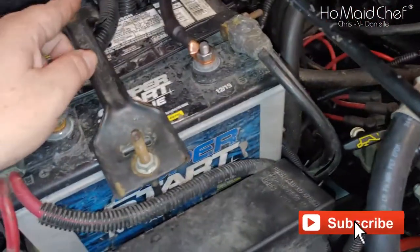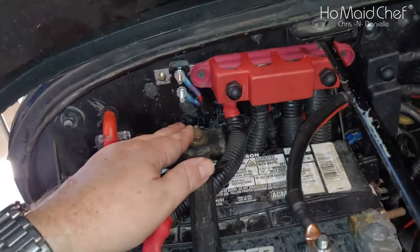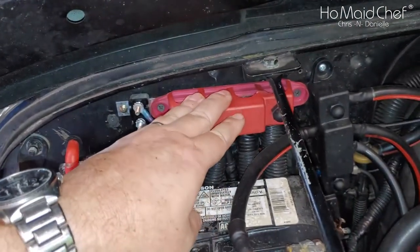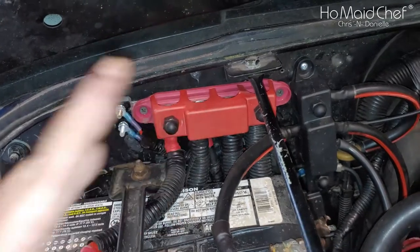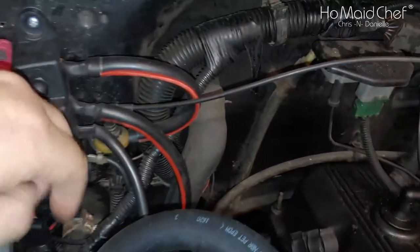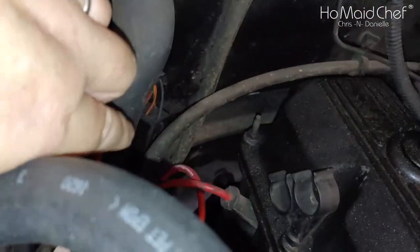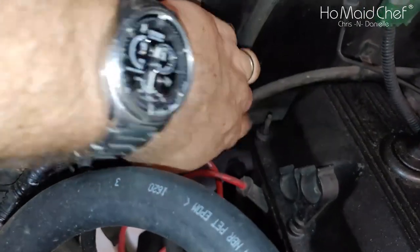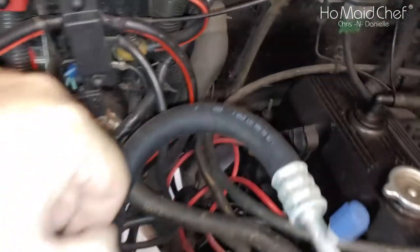I have it running back behind the battery through holes I already had for the audio equipment. I also did a rewire project using bus bars — really good. Where they installed it, they drilled a hole through the firewall back here and then put some goop on it, and there were some jagged edges. Wasn't going to leave it like that.